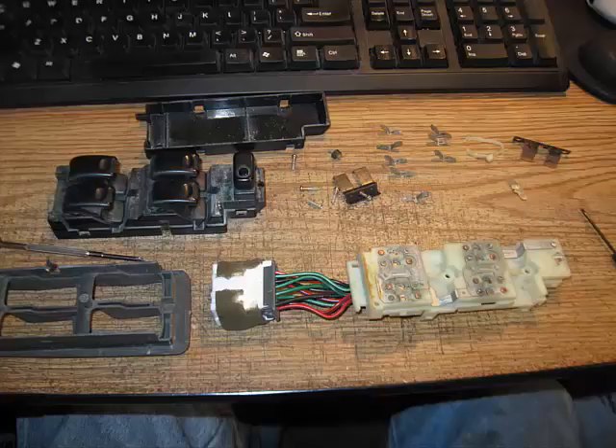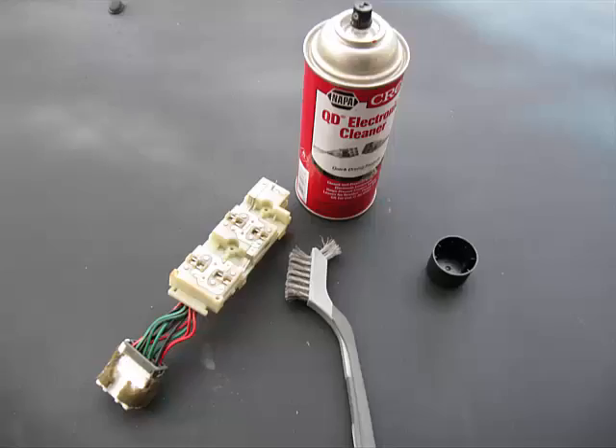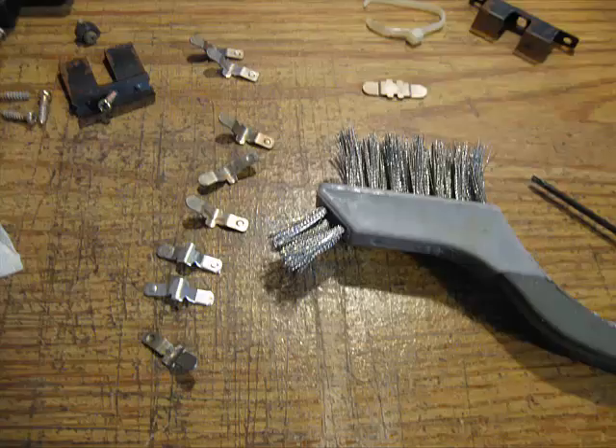As you can see here, I had to actually disassemble the control panel for the driver's side — you can see how messed up it looks. Then I got some electrical contact cleaner and a wire brush and cleaned all the contacts and connecting pieces. You have to be careful with older model cars because the plastic gets really brittle and things will start to snap. You can often buy a new control panel online, but they can get pretty pricey, so if you can clean up and use what you've got, that's probably the best way to go if you want to save money.